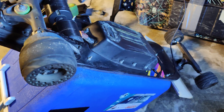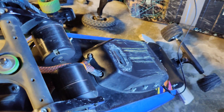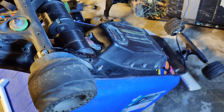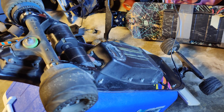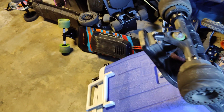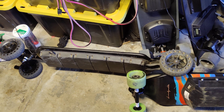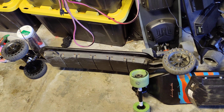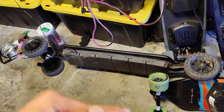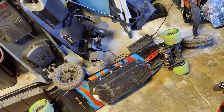I was thinking my battery died, but there's no way it could have — it just depleted because I had the power button on. It was at like 35 volts, and this battery pack is supposed to be zero percent around 36 volts. I've been reading a lot of comments online where people say 'I bought an Ownboard and it doesn't charge after the first charge' — what might have happened is you rode it all the way to zero, didn't charge it for a couple days, and the voltage dropped below where your charger would work. Try that and it should fix your board.